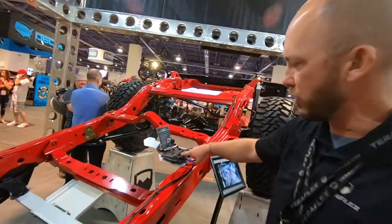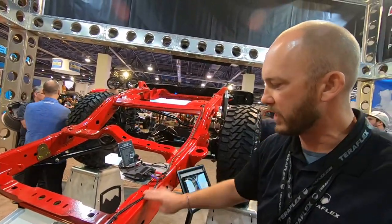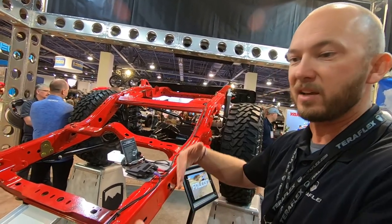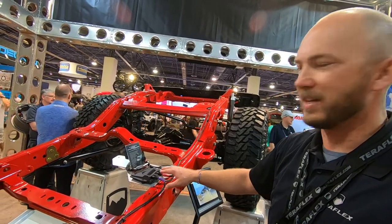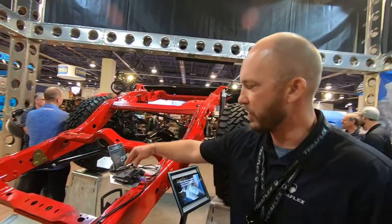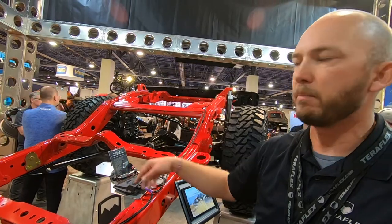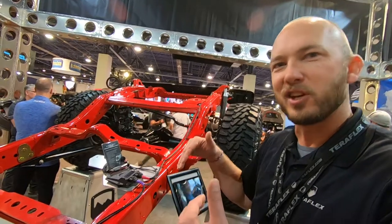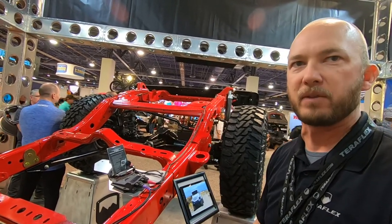This brain underneath the seat — you can see everything is closed wiring, waterproof, because this is going to be outside the vehicle. Now if you want to take it a step further, we have our E-Adjust with Adapt. That's going to have a different computer board on it. It's going to sync via Bluetooth to your cell phone with a free downloadable app, and it's going to change the firmness setting on the shocks automatically as you're driving the vehicle.